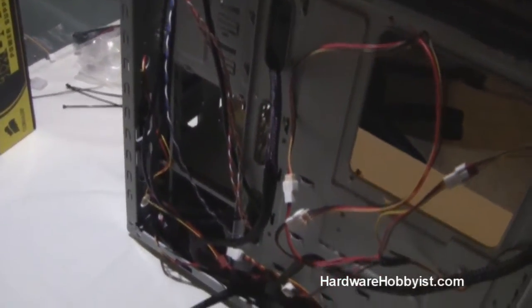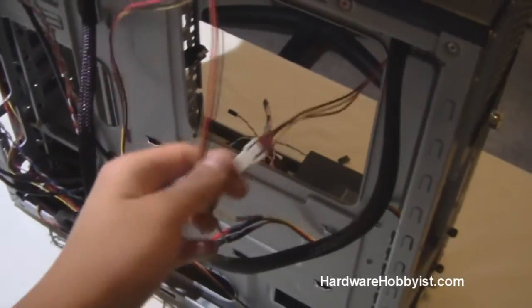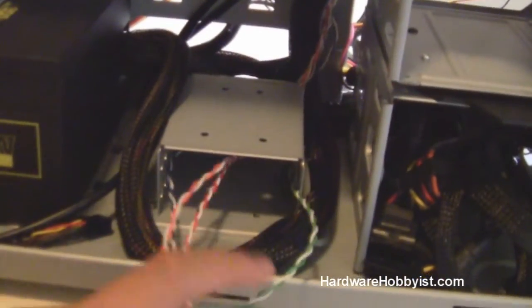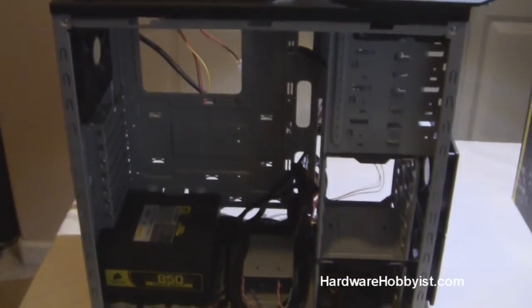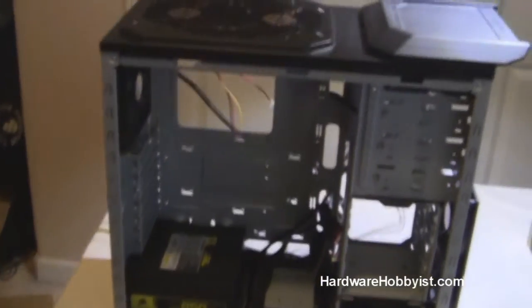Alright guys, as you can see here, Max and I have been messing around with the cables and we've stored everything that we could behind the motherboard tray. Here's a splitter for the fans that we connected in use, and here's a bunch of the cables that we don't need just kind of stowed under there. Now let's move on to the front — pretty clean. The case headers are tucked under here for use. Of course, when we actually plug in the motherboard, simply just bring them up a little and plug them in. Same with the USB headers and such over here. Yeah, it looks a lot cleaner than before if you just kind of shove the cables everywhere. So that's going to be our cable management video guide. This stuff does take a little bit of time and can be a little bit tedious, but it does pay off, especially if you have a side window.